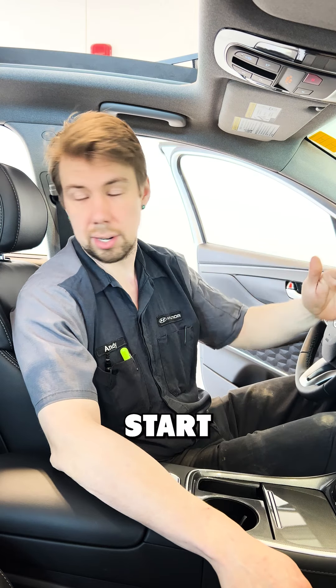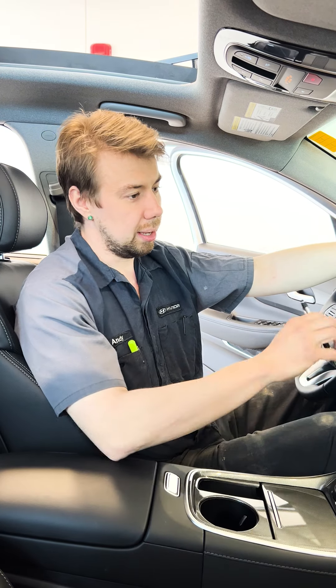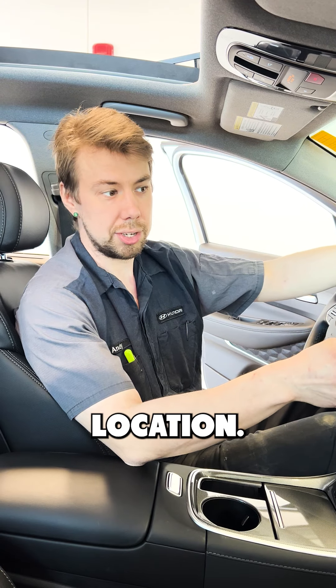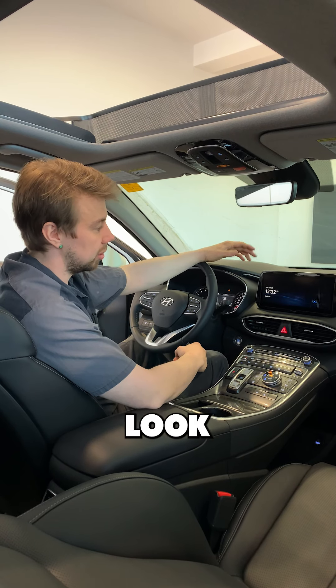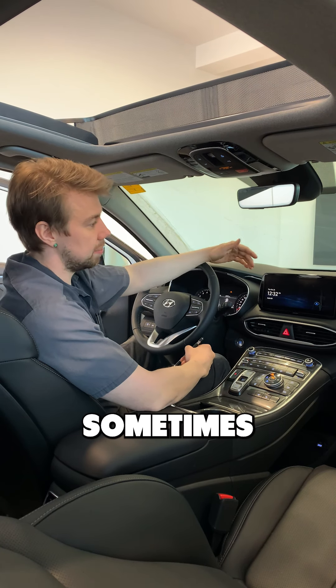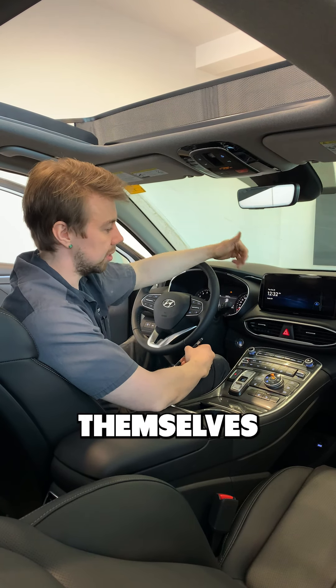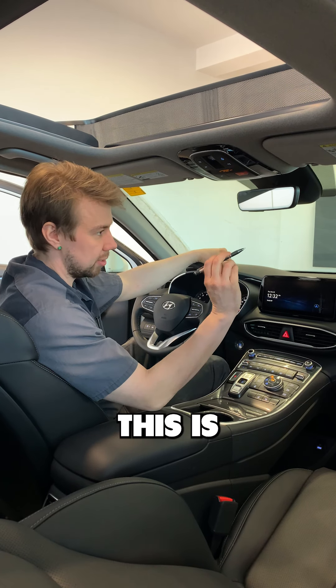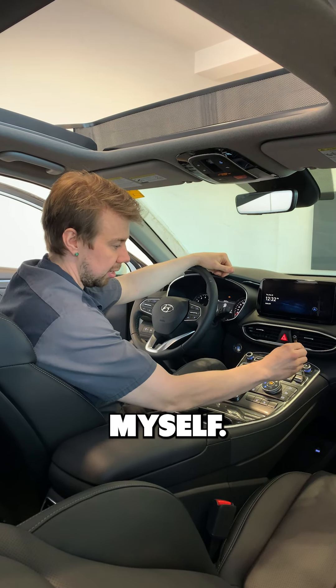Simple thing to do is start your car up outside. If your audio isn't working or your navigation might be showing the wrong location, a simple thing to do is look for the soft reset button. That'll be located beside the tuner knob in this case. Sometimes they're located on the head unit themselves and it'll just be a little button the size of a pen tip, and this is what I'm going to use just to reset it myself.